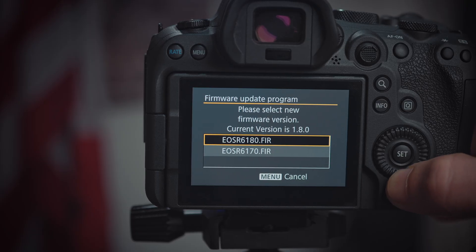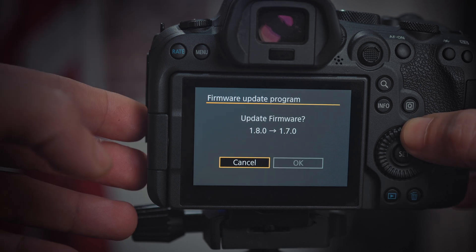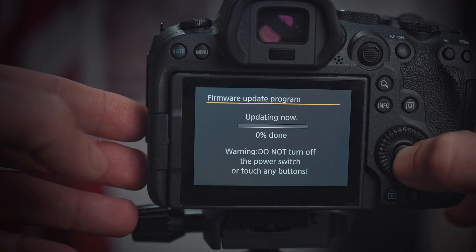And magic — you can now select which of the two firmware versions you want to install in your camera. Of course, now you choose the previous one, the 1.7.0, the one we know 100% is working. That screen won't work during this process, so use the wheel to select it and click OK. Be patient — it goes without saying, make sure you use a fully charged battery, because if the camera turns off during the process it might get damaged. Just don't touch anything and wait.